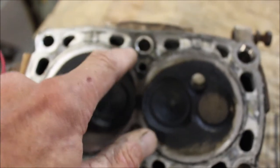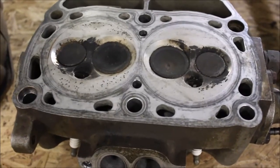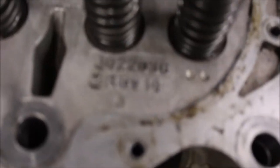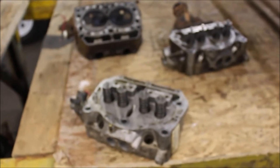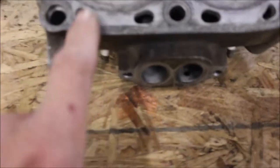I've got the same issue on this one — this is the one sitting on the bench, the warped head. Now this one is off of a 600, and the casting number is the same. If I flip this over, there's a casting number right here — the last numbers are 0, 3, 6 — same number on the other one. I'm going to cross-reference the numbers, but I think those are the same heads. The head off of a 425 is the same for a 500, so I'm hoping between the 600 and the 700s they're interchangeable, because this one doesn't have all that pitting.